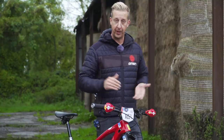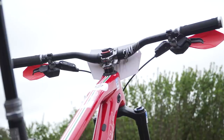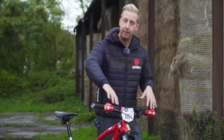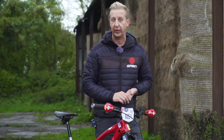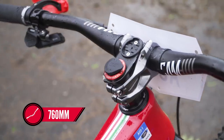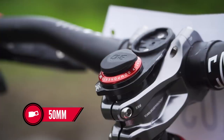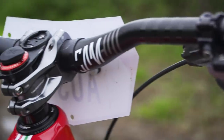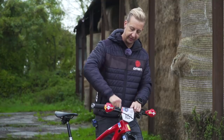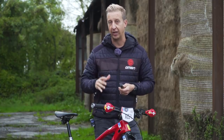Up to the cockpit. First you'll notice the handguards — they're bold red to match the colorway of the bike. They're not everyone's cup of tea, but Sam Hill has clearly made them work. They're customized versions of the AMS guards with red panels and his number 13 graphics. The bars are the Sam Hill Edition Nukeproof bars, 20mm rise, at 760mm wide. The stem is a 50mm Nukeproof Horizon. On top of the stem he's got a OneUp Components Garmin mount, which puts the Garmin further ahead so he can't hit it with his knee, and also provides access to tools inside the steering tube — inner tube, CO2 cartridge, Allen keys, chain tool, all stashed in the head tube for quick trailside fixes.